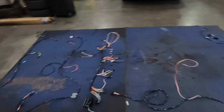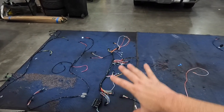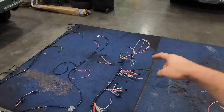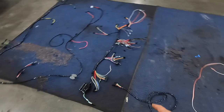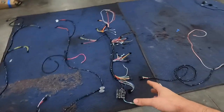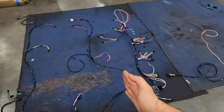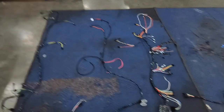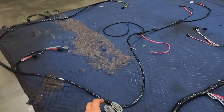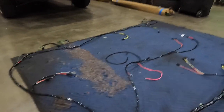All of these circuits go straight to that fuse box — it's the central hub. But it's nice to see how things are wired through the switches and back. We already have the firewall covered. This is where our forward harness and engine harness connect to. You can usually buy these as two separate harnesses: the engine harness and the forward light harness.